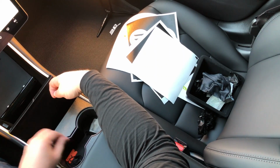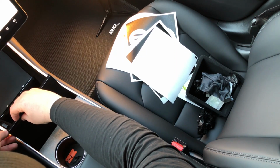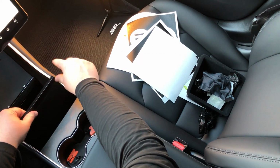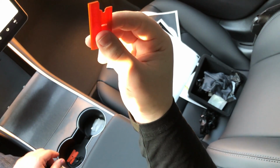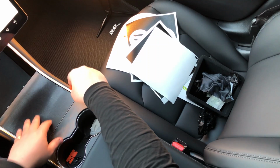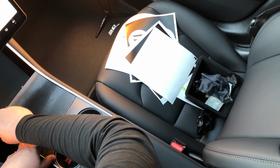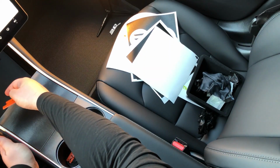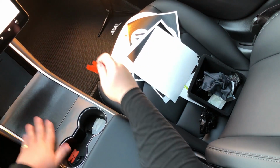And up on this front here, I have a couple bubbles. Easy enough to pull them, straighten them, and get them nice and worked out. Curves around. Now, you're going to want to use this blade, and you just go right along the edge here, because there should be a little bit of overlap on either side, and you just want to tuck it down into the opening along the edge. And that's going to give you that nice sharp edge on the material. There you go, just tucking it around that edge to give the overlap, and then you have a nice sharp install. And it looks perfect.